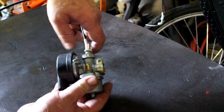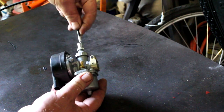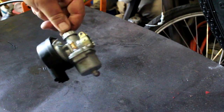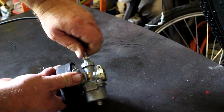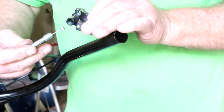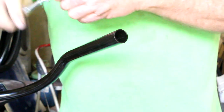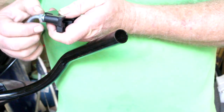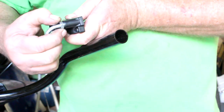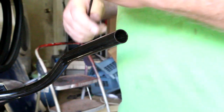Take your time at this point. The needle at the bottom of the slide has to go into an orifice at the bottom. Now we've got some slack in the cable at this point, but don't worry about it — we're going to take care of that once we get the handle assembly taken care of. The other end of the cable screws into the throttle housing; screw it in and leave a couple of threads out because we need to put the retaining nut on. Just tighten it by hand for now.